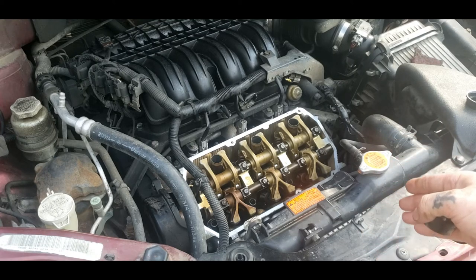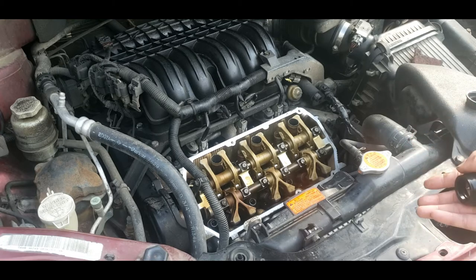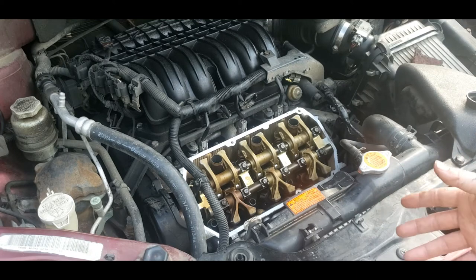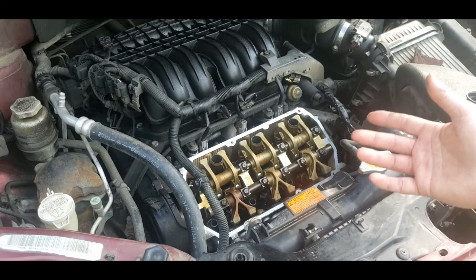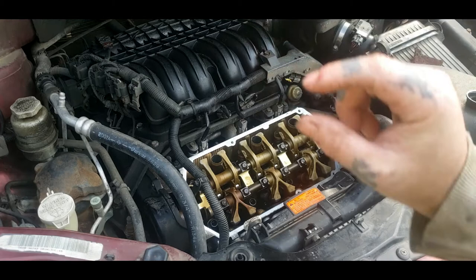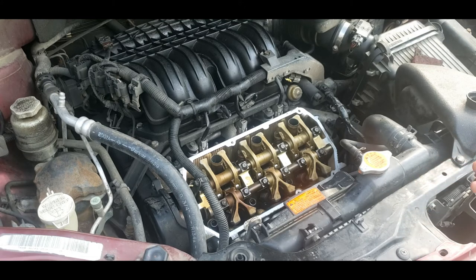But the factory ones are around 44 gap. I don't know if Mitsubishi changed that recommendation later on, and that's how come that, or NGK didn't. But I'm going to leave mine at the NGK recommendation of 32. The reason for this is because it'll wear down over time. It might give you more life in your plug. And on these older engines, actually less wear on your coils too, with not having that wider gap. So countless reasons. And the other people that have installed the same plugs as I'm installing here, they haven't gapped them to 44 and do just fine. Many reasons.